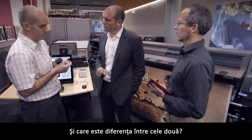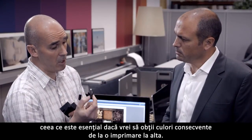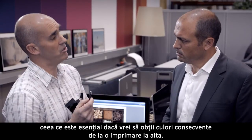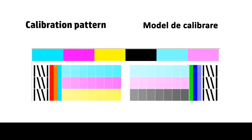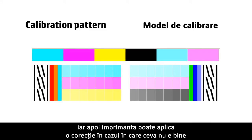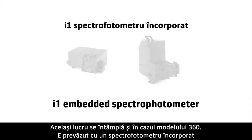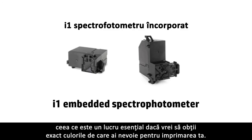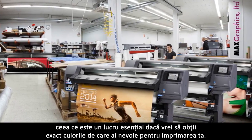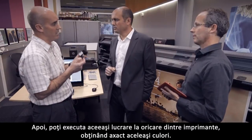What's the difference between the two? The embedded densitometer on the 330 and 310 is a color sensor used to calibrate color — essential if you want consistent color between prints. The printer will print a calibration pattern, the sensor will scan that pattern, and the printer applies a correction if needed for the best color output. The 360 has an embedded spectrophotometer that does the same function but also lets the user generate an automatic ICC profile — essential if you want to hit exactly the right colors. It's also very useful if you have multiple printers to calibrate those to the same target, so you can do the same job on any printer and hit the exact same colors.